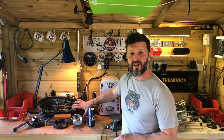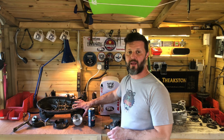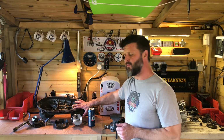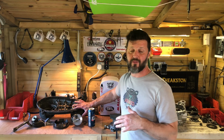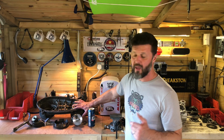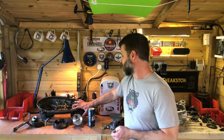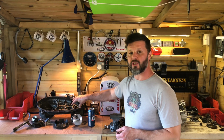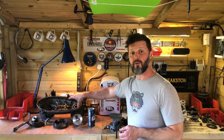You don't hear so much of those little Imolas anymore with all these fabulous things that are coming out at the minute, multi-horsepower this, that and the other, and exotic this, that and the other. And I think the Imola is still probably, I really like the TS1 kit as a 225, as a big block kit. And the Imola to me, they used to call it the baby TS1. So there's a lot of good all-round features on that kit which lend themselves to different criteria depending how you want to spec up the rest of the top end.